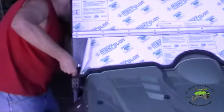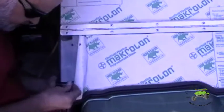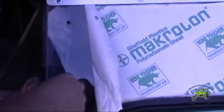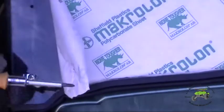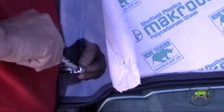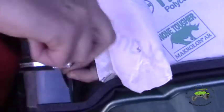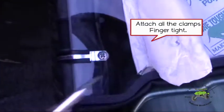Set your windshield on there and put your little bracket through there. We do make these kind of tight, so I'm not going to tell you this is the simplest thing in the world — we didn't design it to come on and off, we designed it to stay there. Sometimes you have to feed your bolt or nut down through there a little bit. When you're tightening up, I always give a little bit of pressure, keeping my hand there to keep the fingerprints off. So we got that right there.